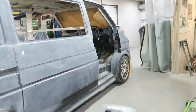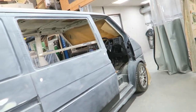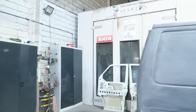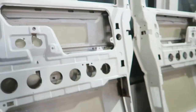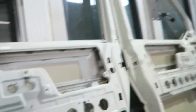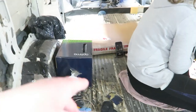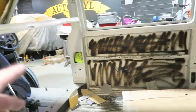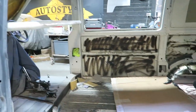We're getting close. Another Saturday now — just the final stretch before it goes into the booth. Just going to block off the bottom part there and get a few other bits done, then it's going to be DA'd in 500 to get it all flat ready for the booth. I've taken loads of weight out — here are the doors, these are 44mm holes. I've cut the bottom of the door out as well and I'm just going to have it all gun damped and black on the inside. Mrs is scraping away on the inside — you can literally fill carrier bags of this stuff. It comes in big rolls and anyone who's ever soundproofed a van will know how heavy it is. Back in my car stereo days I used to lag the inside of the doors with it to stop them from vibrating.